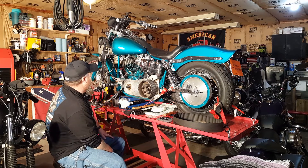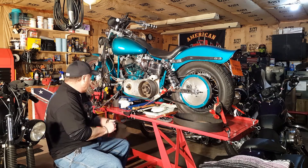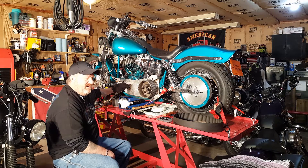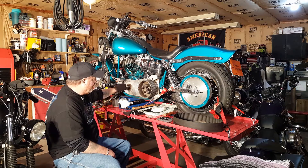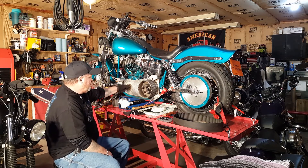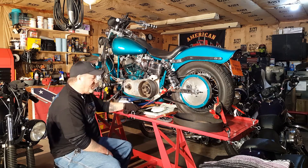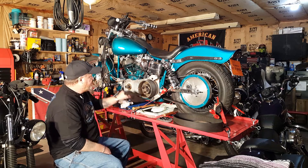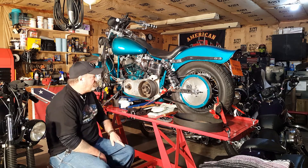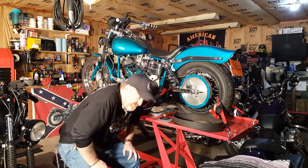I finally got the nut off and that was my biggest battle. I busted a lot of knuckles, but yes — heat it up really well, especially if you Loctited it. Just use a little bottle torch, get it good and warm, put an impact to it, and it'll come right off every time. Take your time when you're working on your bike, sit back and look at it — be surprised what you can do. It is a suicide jockey setup — that's what I put it together as. I'll probably change that because she's been wanting to ride it. Yes, this is my '72, this is what I've been working on in between videos.